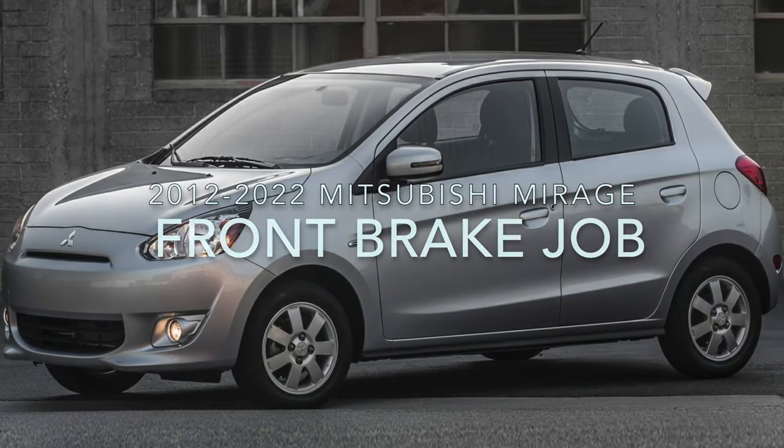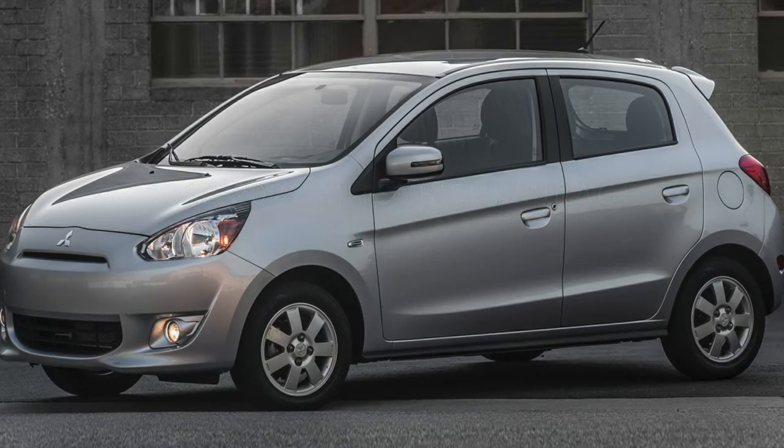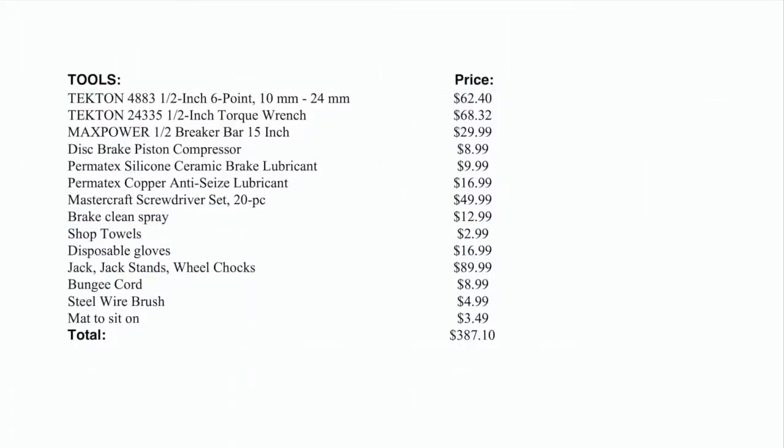We will start off by talking about what tools and parts are needed. The tools we'll need are as follows. You'll need a 21mm socket to remove the lug nuts to take the tire off. You will need a 14mm socket to remove the caliper slide pins to be able to remove the caliper from the caliper bracket. I recommend you buy a torque wrench so you can tighten these bolts back to spec.